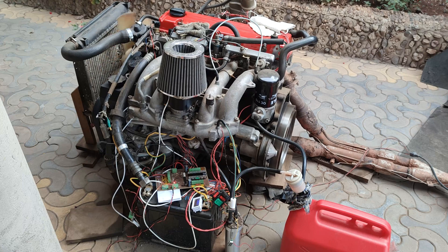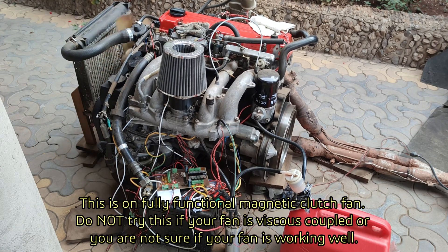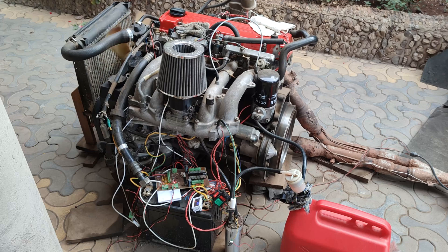When the engine is cold, the fan should be disengaged and you should be able to stop it with your hand quite easily, like so. But if you cannot do that, then it's either shorted — meaning it is on throughout — or the other alternative, which is a shortcut, is that it is normally welded, which is not good for the engine in the long run, because that's an unnecessary load right there.